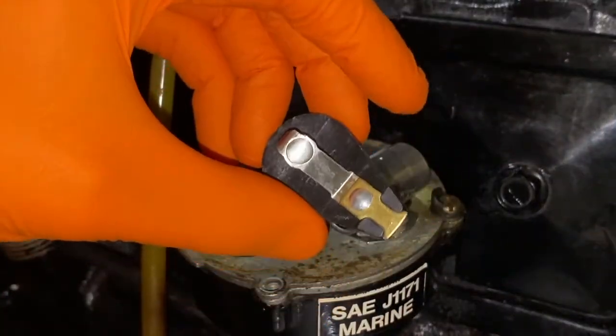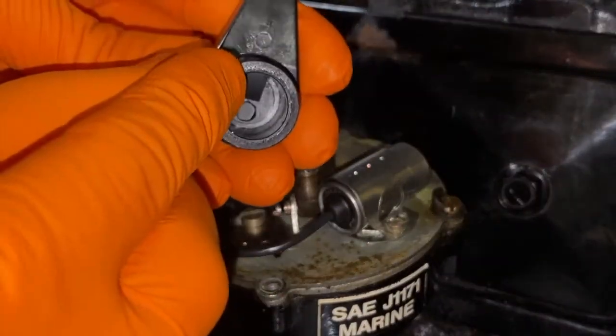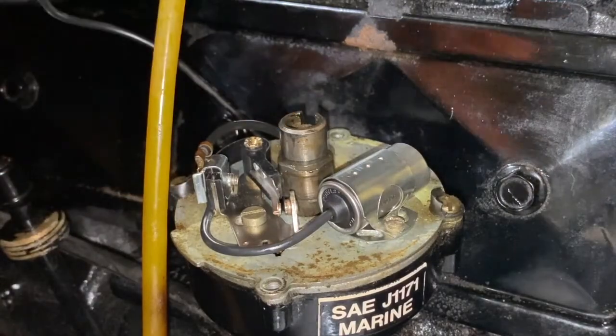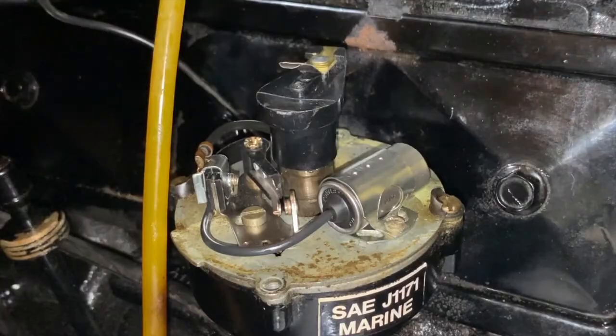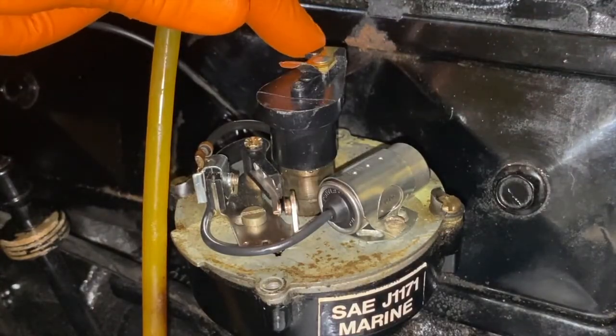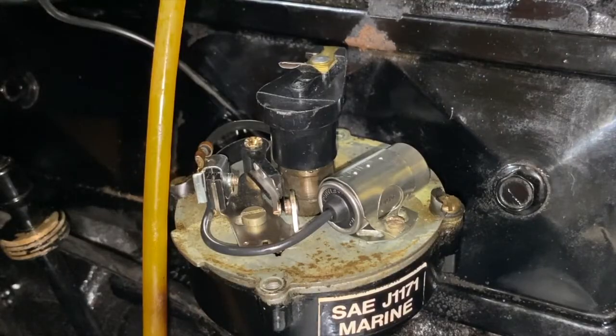Back to the rotor — this is brand new, we replaced everything a few days ago. Properly align that little inner tab right there with the machine slot or cut on the shaft, and push it down as shown there. This part, as the engine is running, is spinning. As it spins, it makes contact with all of the electrical leads or contacts inside the inner portion of your distributor cap, and in return it sends that current through the spark plug wires into the plugs and into the engine, where it sparks the fuel and air mixture.